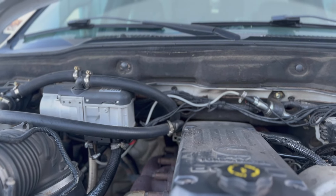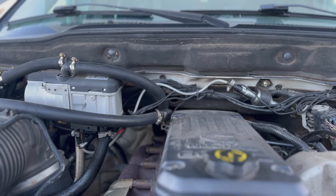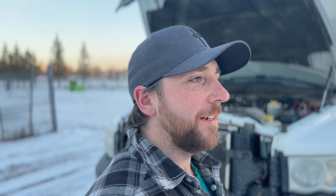I have this unit tapped into my fuel tank, so as long as I have fuel in the truck this thing will run. That said, this heater does have some limitations. It is a Chinese version and I bought it hoping it would work as well as a Webasto or one of the German diesel heaters. It does work really well, but the controller has no timer and you do have to get up and start it manually.